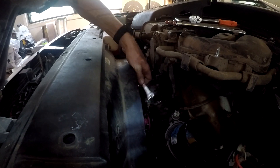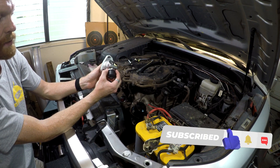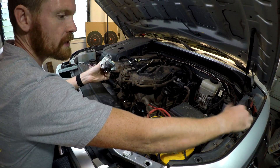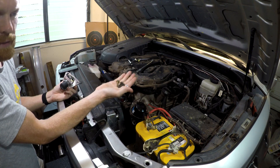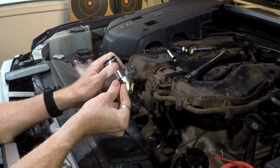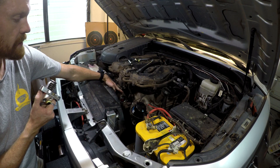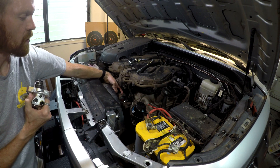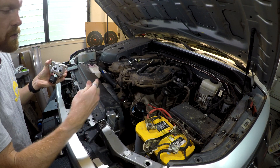The last stud is out and the assembly is ready to go on. I had to use a pipe wrench on the radiator fitting since it's larger than 36 millimeters — the largest tool I have. The bolts I'm using are one-inch long; you can use an inch and a quarter or longer, but you need an absolute minimum of one inch. Stress that: the housing is five-eighths inch thick so only three-eighths of the bolt sticks through, and the water neck is three-eighths inch thick.